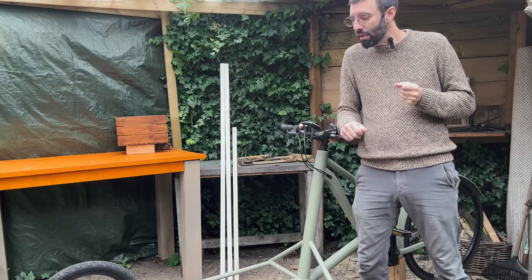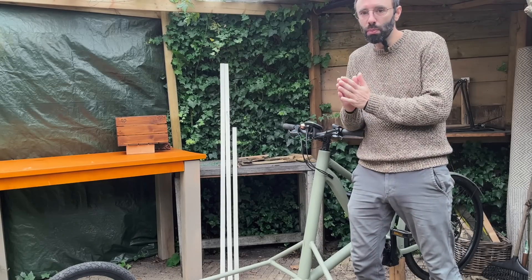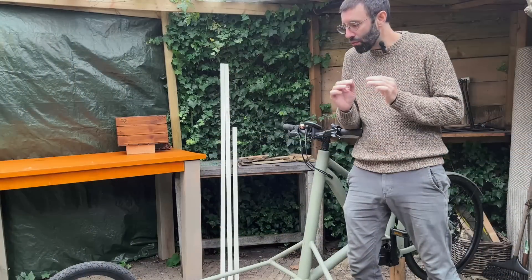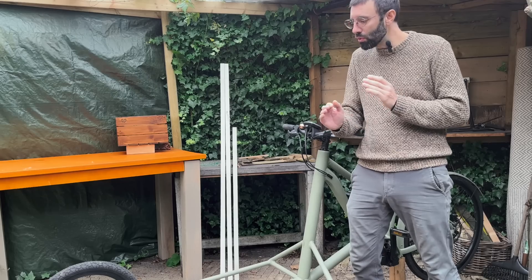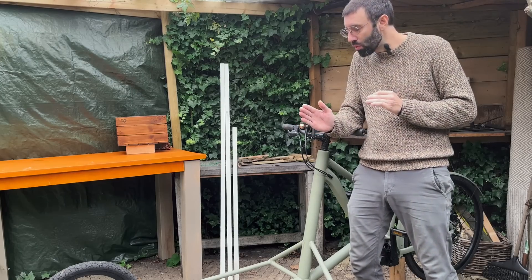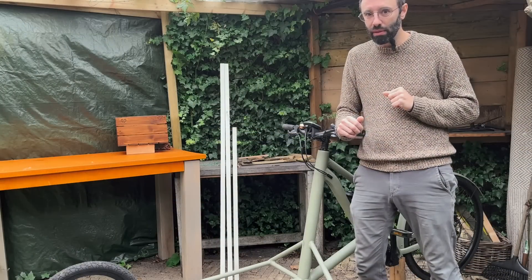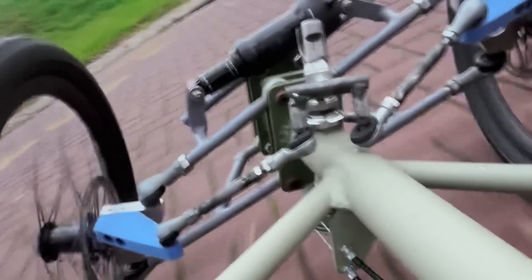And that conclusion is that the connection to the steering has to be inside to the upper ball joint. Now from this point I just have to fine-tune it. To keep the Ackermann while tilting, if this connection is to the inside of the upper ball joint, then I'm on the right path. And after many tests, I have a setup that works perfectly.